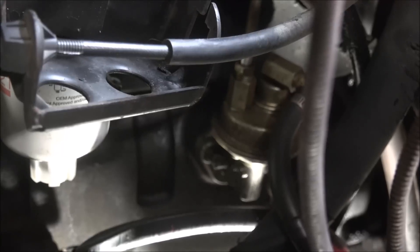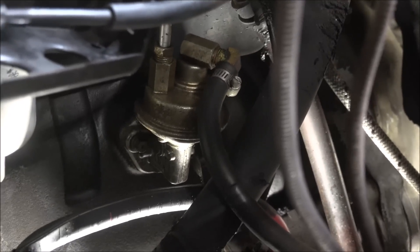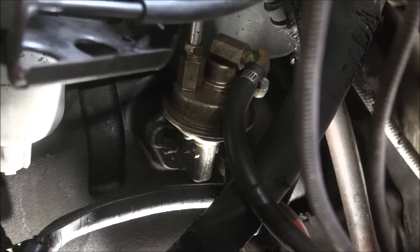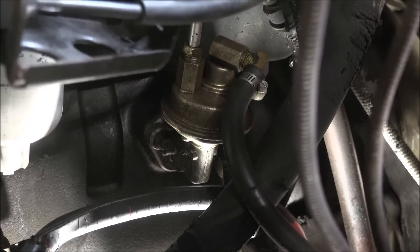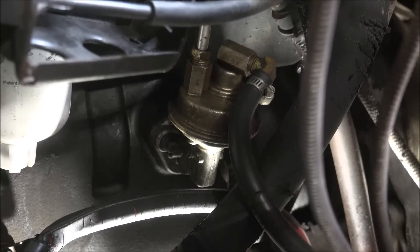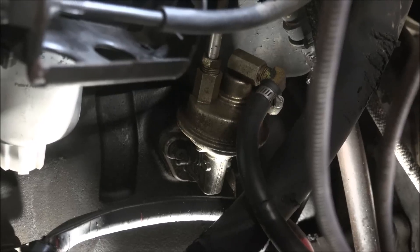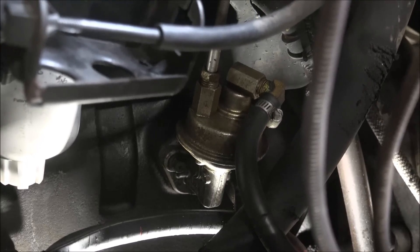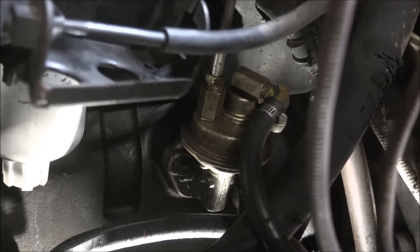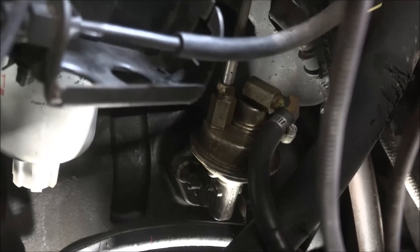Hopefully you can see good enough down in there. That's the factory lift pump — early style. That's the screw-in fitting we're going to rob for the other one. All that appears to be quarter pipe thread, so I have to use a quarter to half adapter to hook that up. Maybe I can make that stock fuel line work — if not I've got another fuel line off another truck that I'll use to make the return out of.